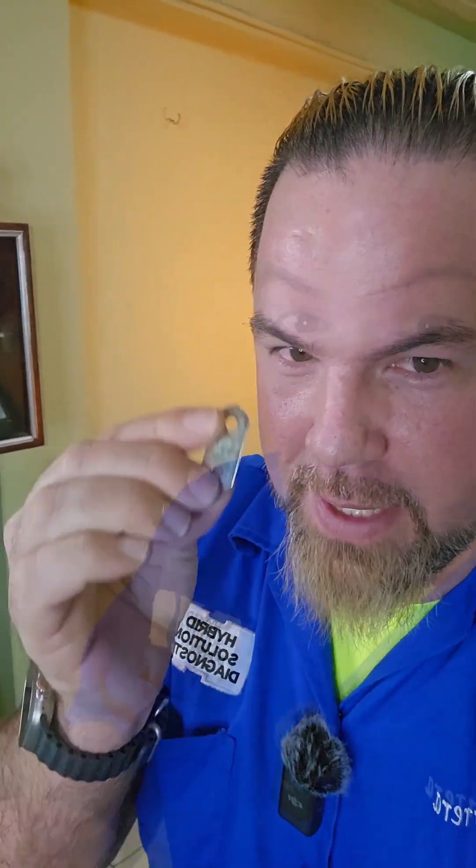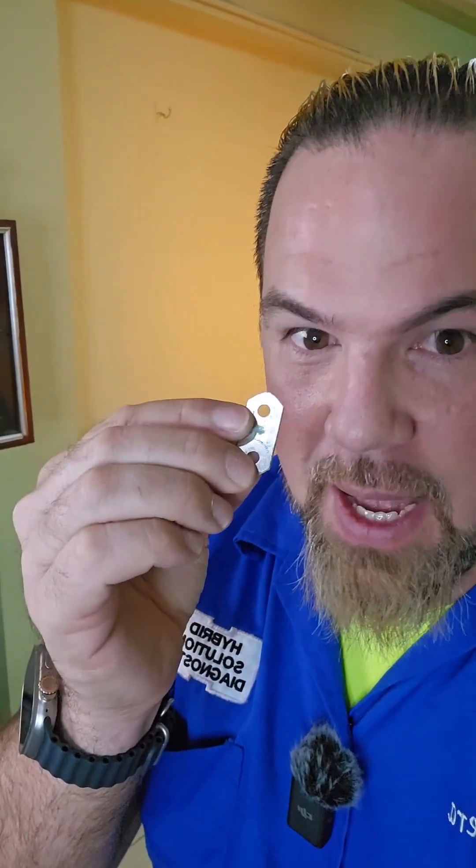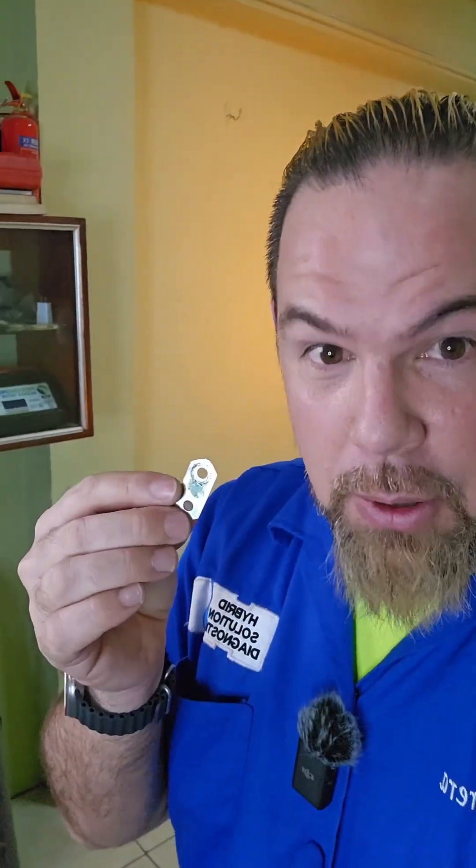What really matters is you have to keep the battery cool and you've got to keep it clean. Otherwise the battery begins to overheat, swells, and leaks the electrolyte, which is exactly what causes this high internal resistance. So the nickel-plated bus bar myth has been broken. Service the battery more often and your battery will be as good as it gets. Stick around for more tips — I'll see you then. Bye bye.